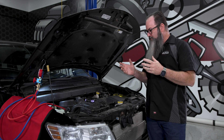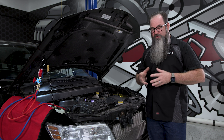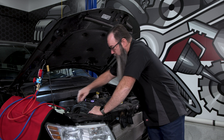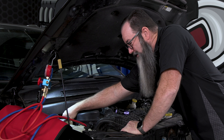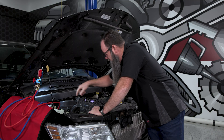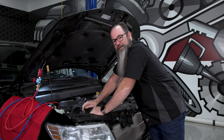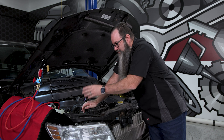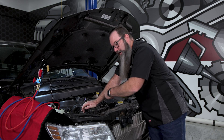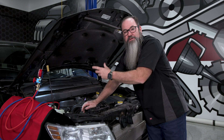One of the first places I like to look on all cars is the Schrader valve — the service valves — as they have a strong tendency to leak. I'm going to go ahead and remove the hose back off of this service valve. I typically look at them prior to hooking up my hoses. I'll go ahead and get my black light and shine it down in there. Sure enough, there is some glow around that Schrader valve. It looks like the Schrader valve is leaking a little bit, but keep in mind — I already had my hose on it. And if I used this service hose to inject dye or to recover a system that had dye in it, when I hooked the hose into it, I could have got some contamination there from the hose.